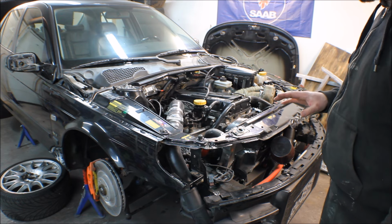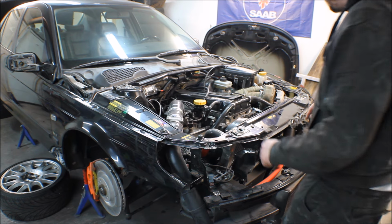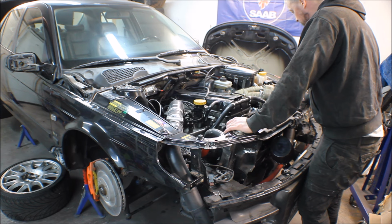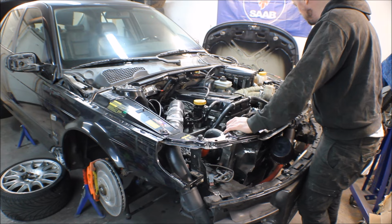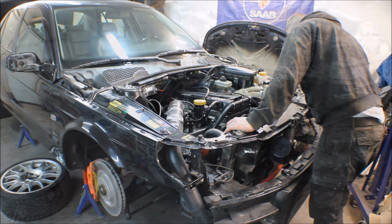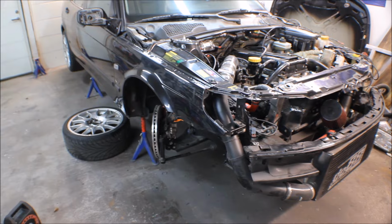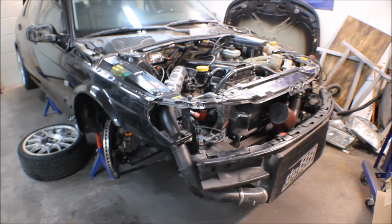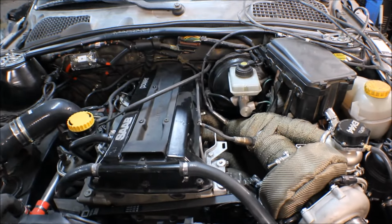It's actually quite a lot of resistance still, so I don't think it really works. So the issue then might be the pump. That the pump isn't pushing out the oil into the steering rack. Because obviously the fluid is moving, but I don't know if you guys have any ideas. What do you think? Do you think that the issue is the steering rack itself, or do you think it's the steering power pump that's causing this issue that doesn't deliver oil to it?